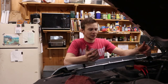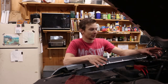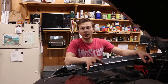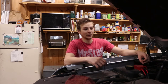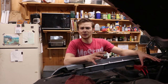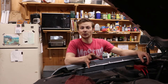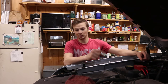For the next part, it's just the basic checking of your engine oil and your transmission fluid. On this truck, you have to have the engine running to check the transmission fluid, so I'll probably do that later. But right now I'm just going to check the consistency and smell. Sometimes if it's really old and starting to get burnt — been overheated a little bit — it starts to smell like popcorn. You don't really want that once it starts to smell like popcorn.